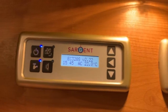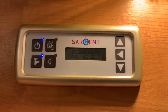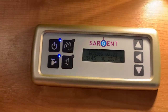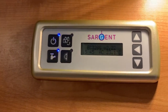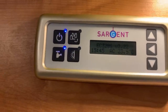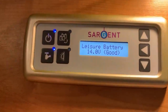That's the overview of how the control panel works with regards to all the screens. Lastly, we have the battery swap. With a motorhome 12-volt system, typically the motorhome can only be connected to one battery at a time — it's either going to be your leisure battery, which also has access to the output from the mains powered battery charger. So if you're plugged into electric, the connected battery is the one that will receive the mains recharge — in this instance, the leisure battery, which is the case 99% of the time.